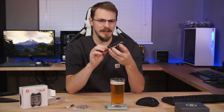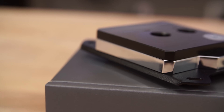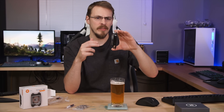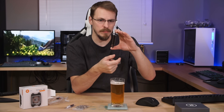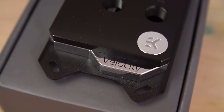This is the acetal and nickel block, and I have to say it's a very good looking block. It's a little bit heavier than I remember the Supremacy's being, and I think that's because of this two-tone design they have going on now. Before, with the EK Supremacy, the acetal block was just a block of acetal on top of the cold plate. Whereas with the Velocity blocks, there's almost a three-band system: you've got the top plate, a center plate, and then the cold plate underneath your mounting bracket.